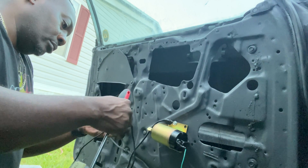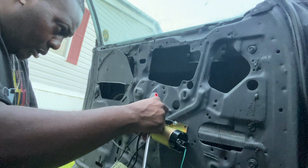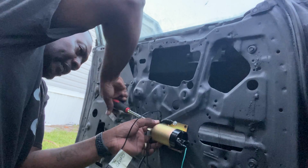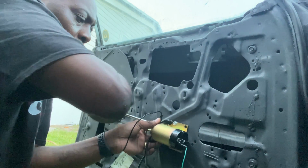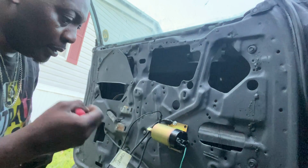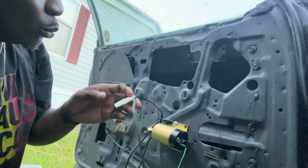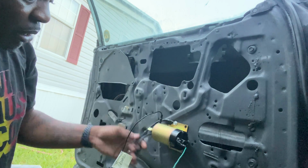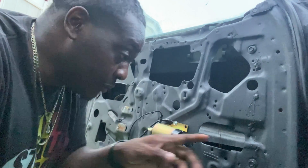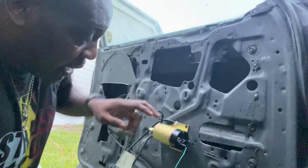And what I'm gonna do is I'm just gonna stick it on the same one I had the solenoid on. Now, you get some people, I will tell you, they will put resistors in line for these things. The reason they put resistors in line is because you don't want a negative going back through your hot wire. Now, me myself, when I use my hot wire, I'm gonna put me a fuse. That's why I'm running it all back through the actual door. My grounds can stay here, and this actual ground right here will be to my door panel. But I'm gonna run it all back through the door, and then this hot wire right here will go to a fuse on its own, so I know that I can label it door popper.